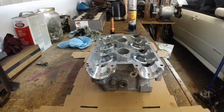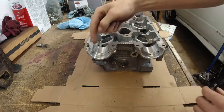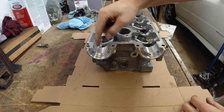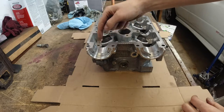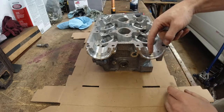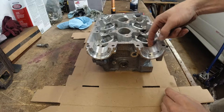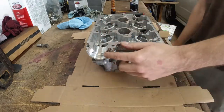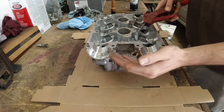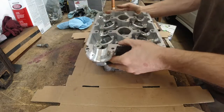Don't forget these little holes here — there are four of them and they just go straight through. What happens is when you have that oil seal there, the oil needs to go back. As the oil comes down and collects, it goes in, the seal stops it, and then it goes back inside the head. These are just through-and-through, so blow air to the outside. This one is ready to go.